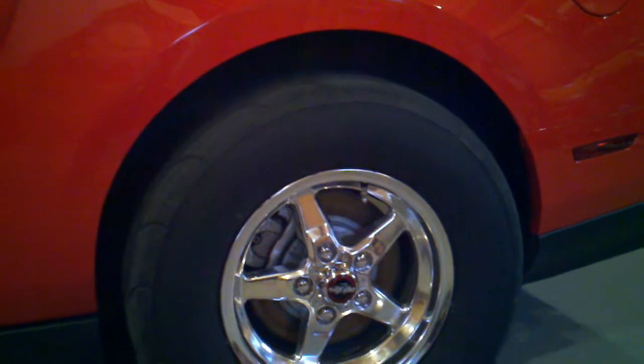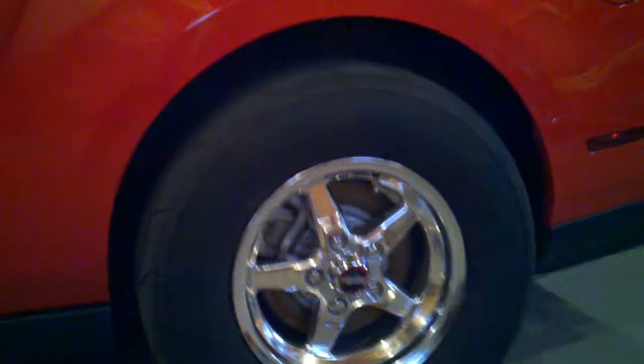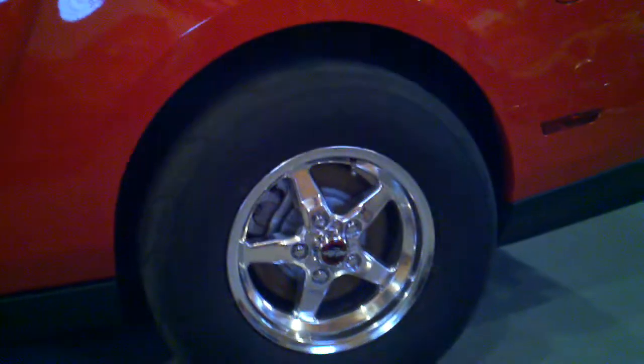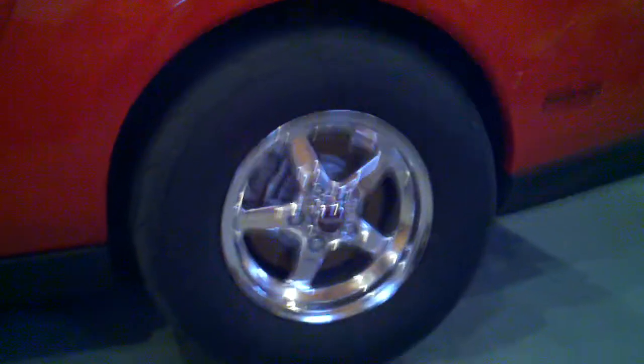The one-and-a-half inch drop caused the tires to rub on the inner fender well, and I don't really want to bust my fender or bust the tire. So I had to put the stock springs back in — it was rubbing on the lip right here. So if you've already dropped your car, you'll need to think about putting your factory springs back in the rear.